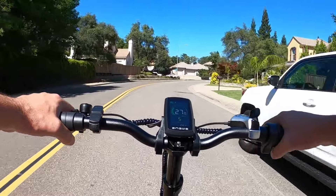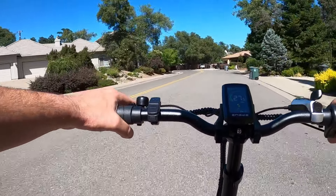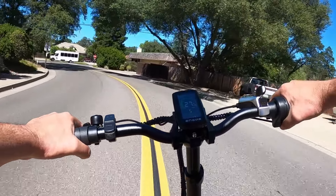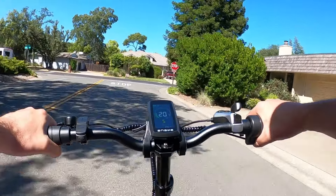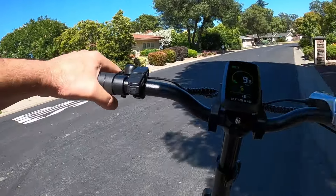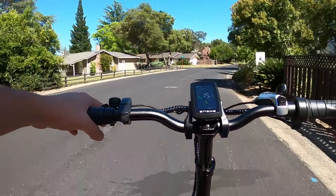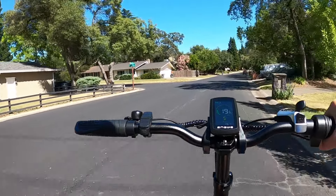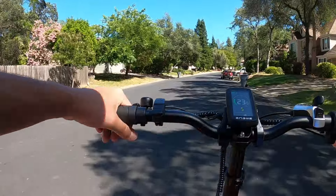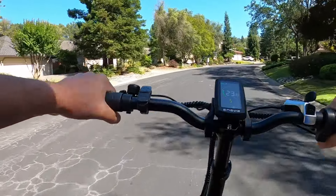Now I'm going to see how fast this thing can go. We're at 27 miles an hour — I'm barely pedaling, getting a lot of ghost pedaling at this speed, but 27.5 miles an hour. With a cadence sensor, you don't have to worry about ghost pedaling like you do with a torque sensor. With a torque sensor, you need to be applying a lot of pressure to get that top speed and power out of the motor. Whereas with the cadence sensor, it gives you all the power based on what power level you're set to, regardless of how hard you're pressing on the pedals. So you can ghost pedal, just keep the pedals rotating, and go full speed — which is really cool.